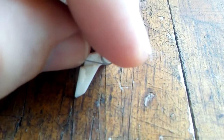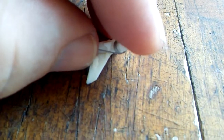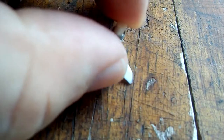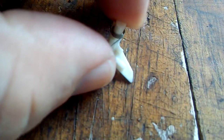If you have a look here, you can see the other end of the spring goes through here, and your gold coloured tooth locks around this plastic notch here, and it should lock the spring into position so it can't fall out. Now if you've broken your finger and you've only got half a finger, that's okay, as long as you've got one edge that goes up the edge of this white bump. That's enough. The super glue is enough for it to hold it into position.